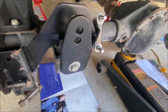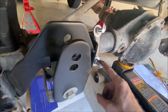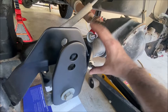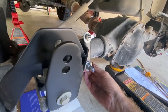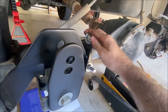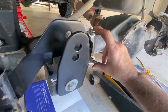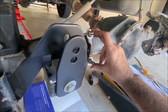I'll tighten the U-bolt to 75 foot pounds and both track bar bracket bolts to 85 foot pounds per the instructions, doing it a little at a time so everything loads evenly. Final update: I did torque to 75 foot pounds, but I'm really worried that anything more than 45 on the frame bolts is just pulling the frame backwards and risks stripping the bolts or the frame. I'm leaving it at 45 foot pounds — the TeraFlex spec is 85, but that's what I'm doing.